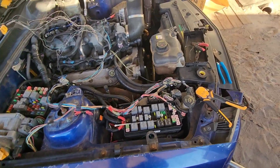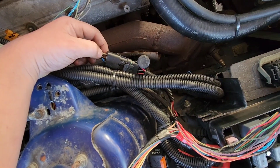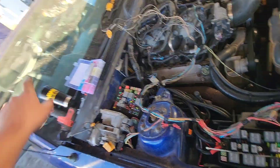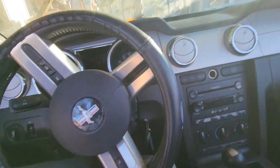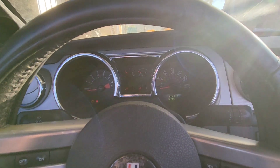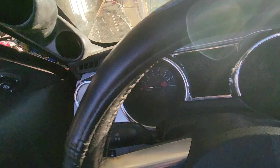So this is the current status of the wiring. We've got our nice plug put in — this has our power to the Chevy computer, oil pressure in the middle, and the gray one is the fuel pump signal that goes through this plug. The green goes back to the fuel pump we wired in the back — that works fine. I also installed a relay for the fan; I ditched the factory Ford fan controls, it just comes on when the engine's running. If we go inside the car and turn on the key, the fuel pump will prime. You probably can't hear it but the fuel pump primed, and if we start it, it keeps running — and the fan is on now.